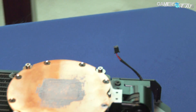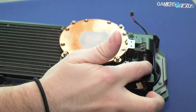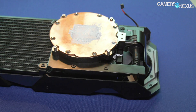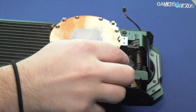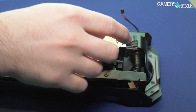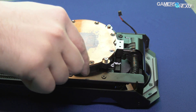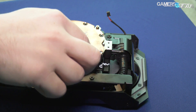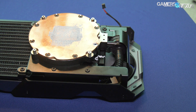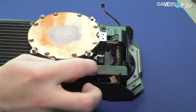The pump is right here, integrated in the shroud. The tubing looks like the kind that has a Teflon inner liner on it, which helps with permeation. You don't really want to use this in a closed loop on a CPU where the user is bending it, because it is a bit more fragile to bend. But if it's pre-installed by the manufacturer, it's a better use case — and that's what's happening here, because they're going to route it in a way that won't crack the Teflon.